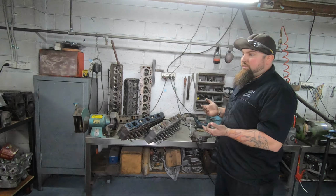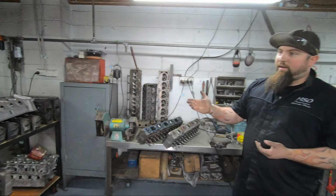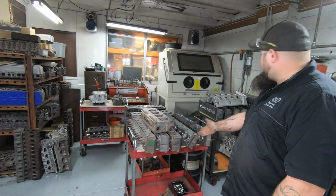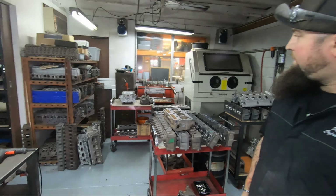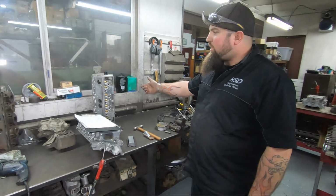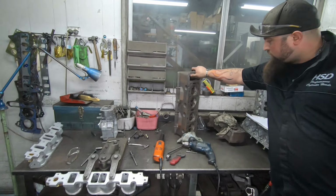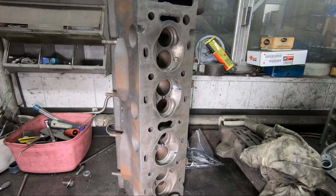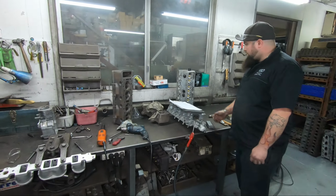Greys, blues, as you can sort of see around the joint, there's a mixture of everything. We've got Cadillacs, Holdens, V8 Holdens, Alfa Romeos, small block Chevs, but we also do crack repairs, as you saw Ed welding the other day. So we find the cracks and we'll end up grinding that out and welding it up.